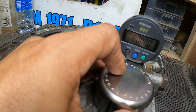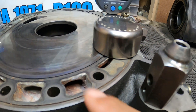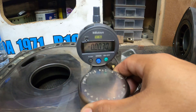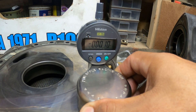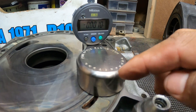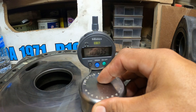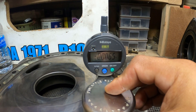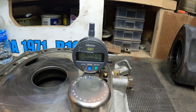It's a bit hard to do this one-handed, but it's already at zero. As you move the indicator toward the groove, you want to lift it slightly, always keeping your base on the reference area. Then just move it outward - and there it goes, the numbers start moving. Right away it's already at 30, dropped all the way to 65. You want to go back and forth, maintaining the base on this edge, just moving it back and forth.